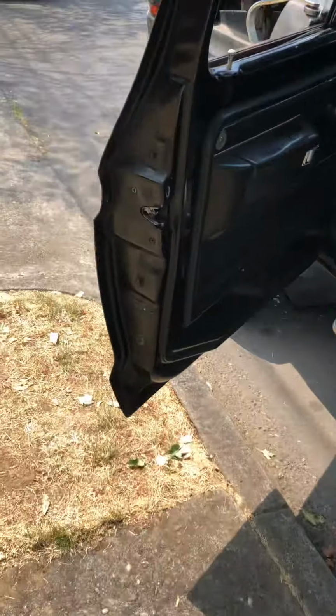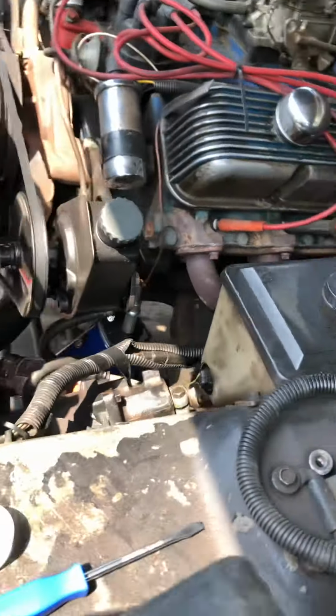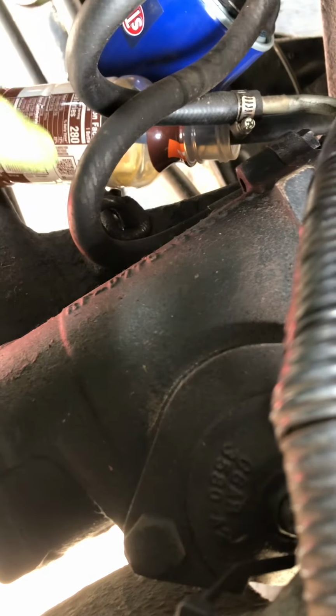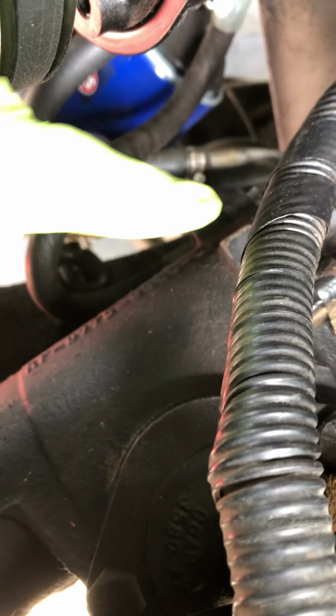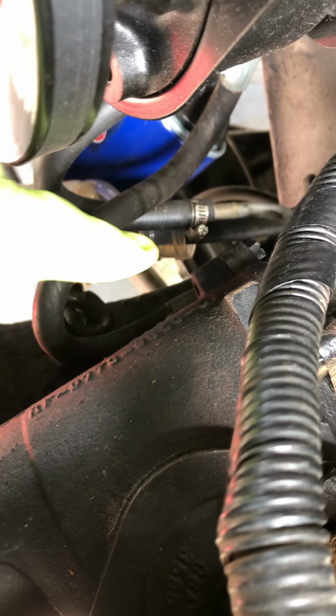And sure enough, I got plenty of fuel. It was only 1 or 2 puffs of air that I gave that thing. I'm sure you can use a tool for that, but whatever. 1 or 2 puffs of air, and I got fuel in that cup. Plenty of fuel. You can even see it there a little bit. So that tells me that my fuel lines are more or less clear. Sure, there could be something in there, but the fuel filter is new as well.